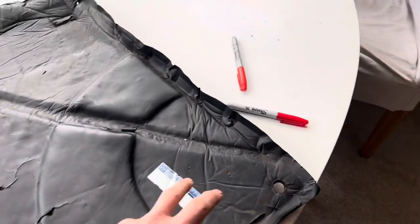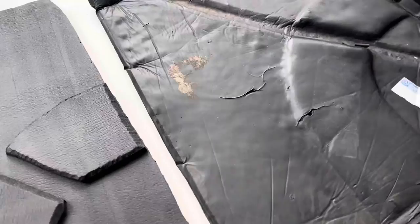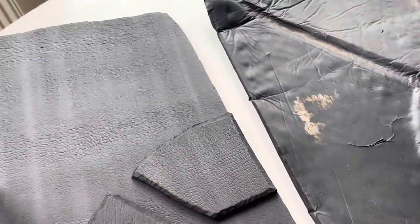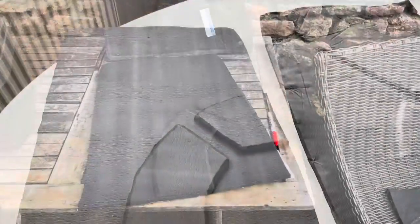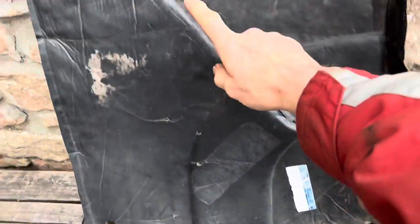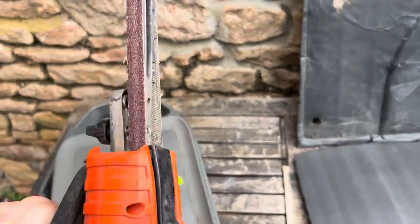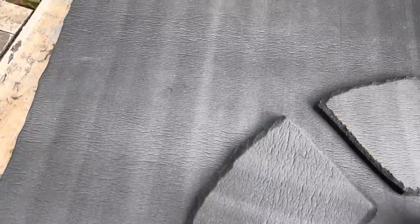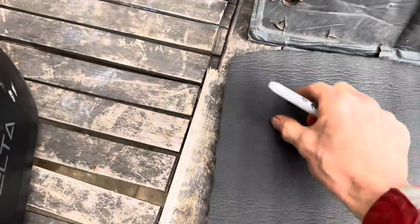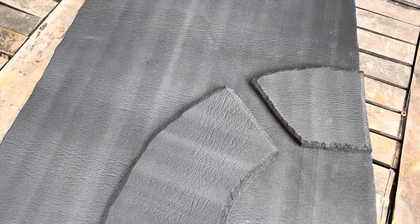This is the driver's side mat, and there's an indentation that runs all the way along it for the cable. What I'm going to do first is show you how to cut out an indentation in that foam. The easiest way to cut this channel is using a finger file — that is how we're going to do it. The finger file will just cut a nice even ridge all the way along there. You just have to make sure you don't press too hard and go all the way through the foam.